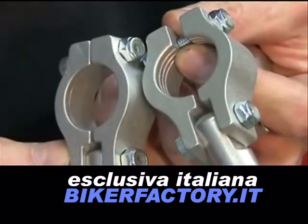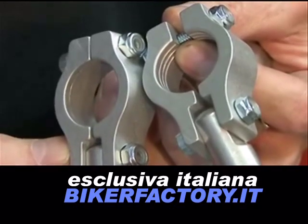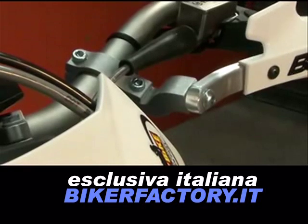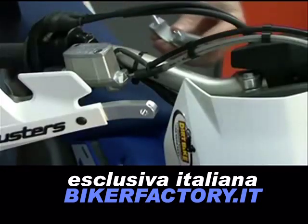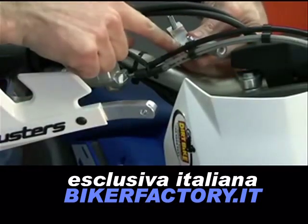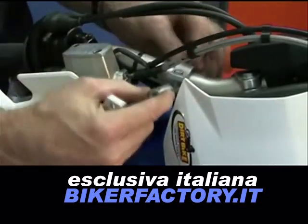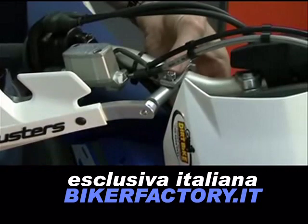Different numbers of rings signify clamps for different model bikes. Some bikes may require an offset clamp connector to clear the cables. Next, loosely assemble the clamp to the handlebar and the handguard. For tapered clamps, ensure that the rings machined into the inside of the clamp surface are on the inside of the bar.